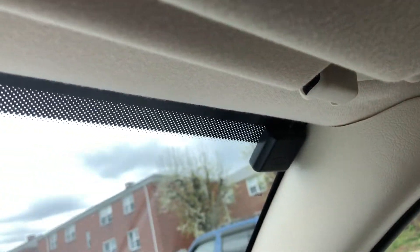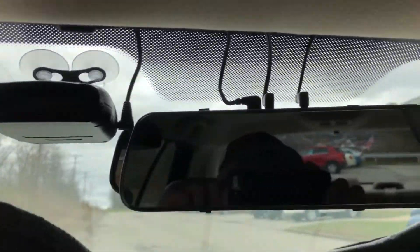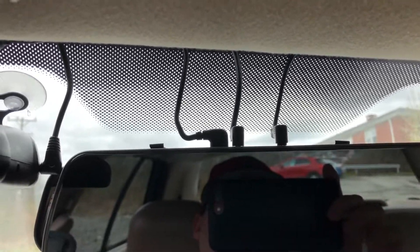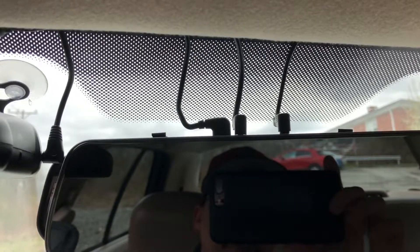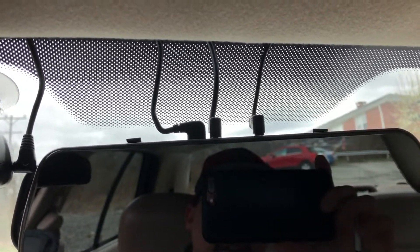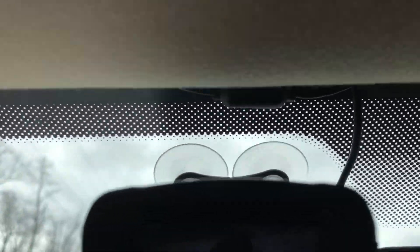You can see I have my GPS — mine comes with GPS and I mounted it there, routed it up in here and then into there. This one uses USB-C. So instead of having the traditional hardwire kit, I had to get just a hardwire female 12-volt socket, which took a little more figuring. Everything's run up here, but for some reason this one had a ferrite core on it, so I had to 3M tape it.